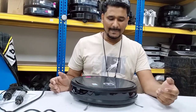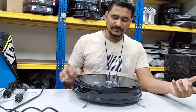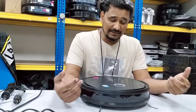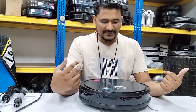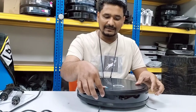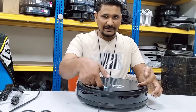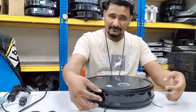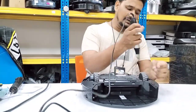It cannot move forward, so it gives the bumper stuck error and stops automatically after a few seconds. This is almost a new model and the customer has used it less than two months. What I suspect is that when we press this bumper it bounces back, but one of the two clips behind the bumper may have gone in and got stuck, and didn't come back up. So we just remove the bumper, reset that clip, and it should be fine.